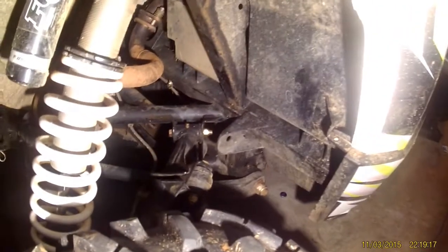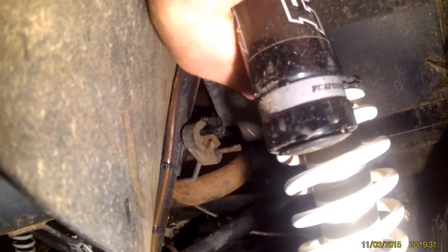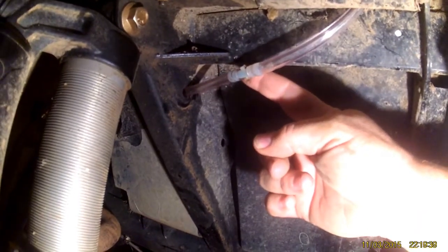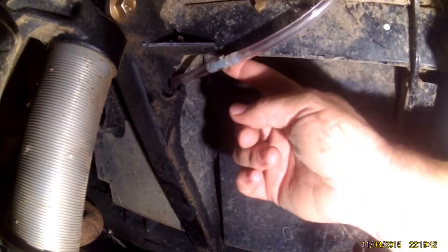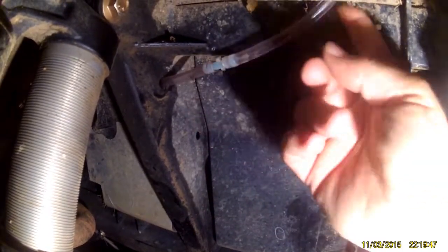We are about seven and a half to eight and a half hours in. I just want to show you some of the items on the snorkel build. Back here you're going to see the rear diff cable — it actually tucks up in a pipe up here. And you'll see a black hose; that's your transmission hose. So you pull those down. Here's the connector right here. You get two of these white clips — they're for both of your differentials, front and rear. I ran it through the frame here, clipped it, and ran it upstairs.